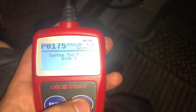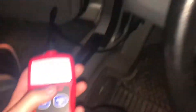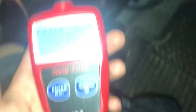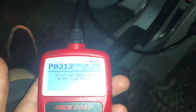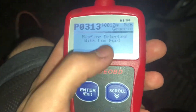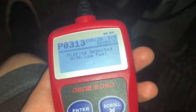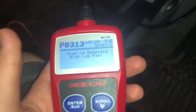Interesting. Let me show you one of the reasons why a generic code reader might not work if you have a luxury vehicle. This actually cross-references to BMW's P1342 and P1343, which is a misfire detected with fuel cutoff — the tank, as you can see, is not low, but the code reader says it's low. It's trying to translate what the computer's telling it; it's not smart enough to tell. So if you're dealing with cars like this, I would 100% make sure you're cross-referencing those codes.